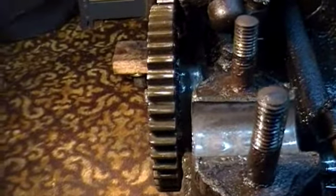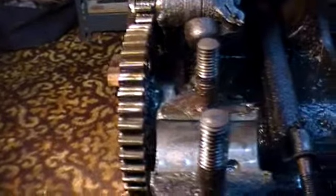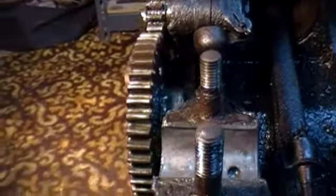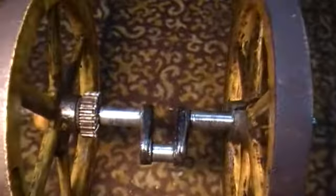The cam gear also seems to have a little bit of play in it on the shaft — I don't know what I'm going to do with that. The bore of the engine looks fine. The main thing I noticed was the crank had play in it — a decent amount of play, more than I felt comfortable running with.